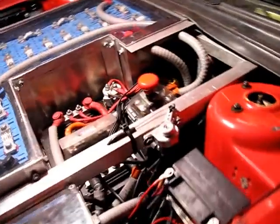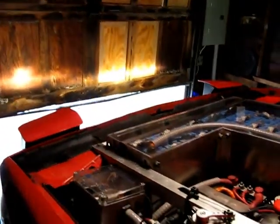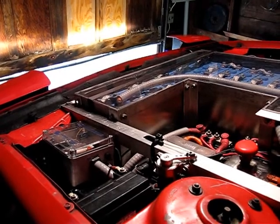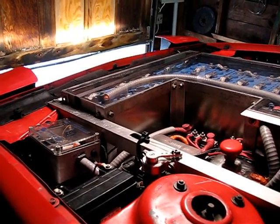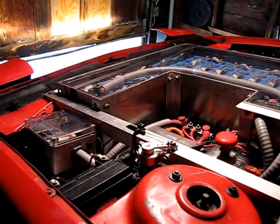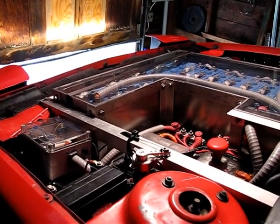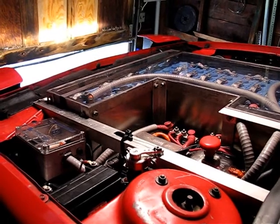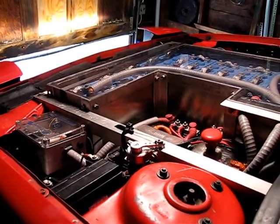I don't get it. So anyway, that is what they do, and I went through and did a test where I turned everything on, had the wipers going, and the power steering pump, and the headlights, and the rear wiper, and all that good stuff, brake lights on, and these two DC-DC converters were able to hold up. Only when I strained the power steering pump, way over to the right or the left, would it drop down to about 11 volts. But they otherwise held pretty well, and I think it is a fine solution.